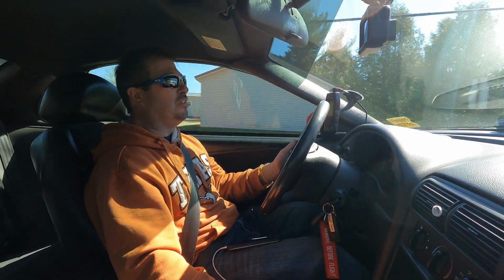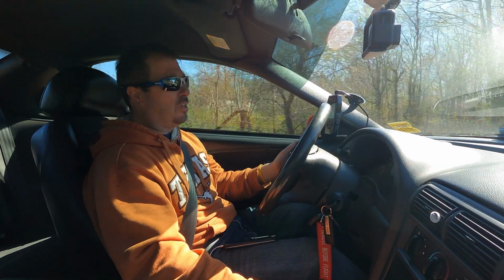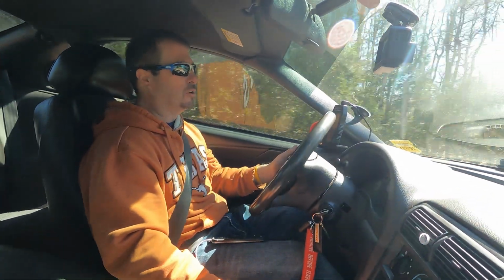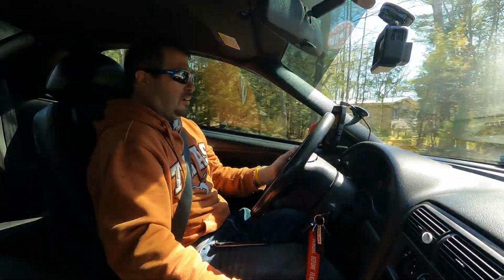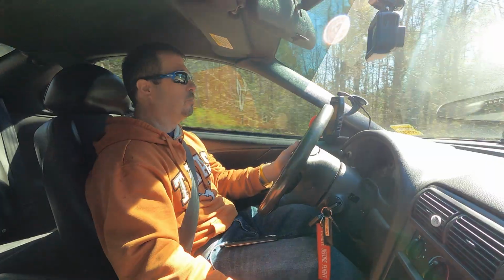So my plan pretty much is I'm going to keep this belt on here. I'll just have to run it without the snub idler, which isn't a big deal. It's fine. I'm not really worried about it slipping or any adverse effects from not running the snub idler on it, so it should be fine.